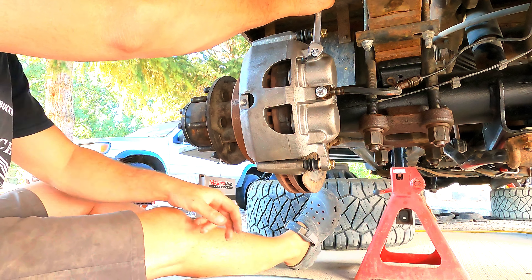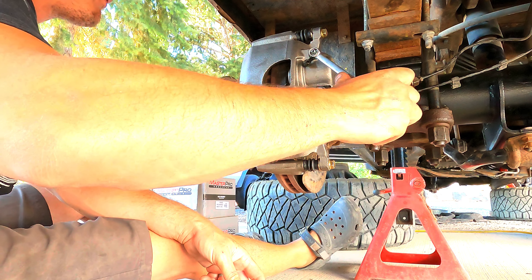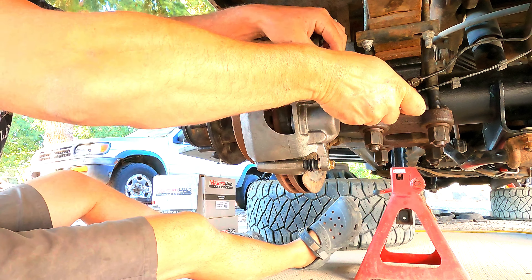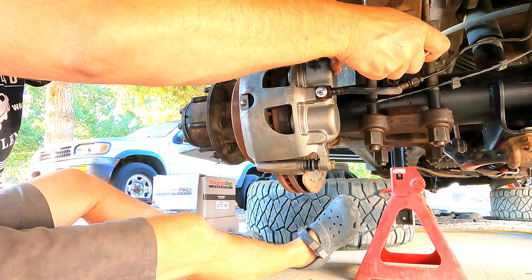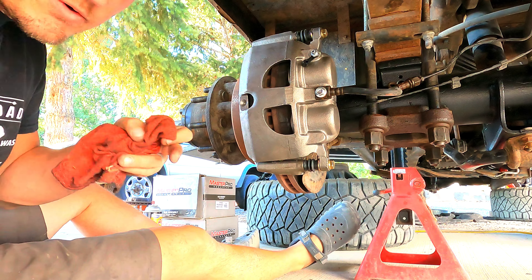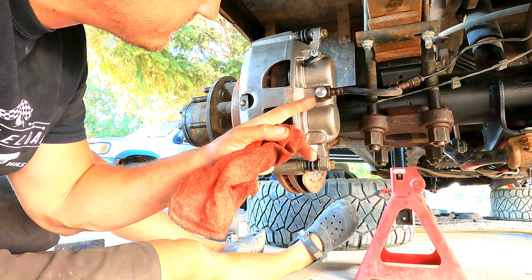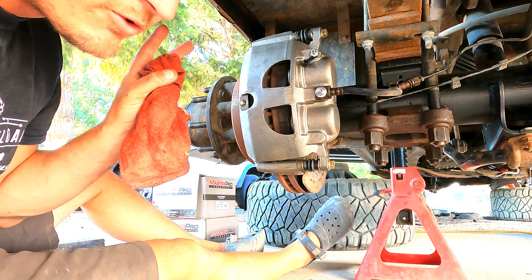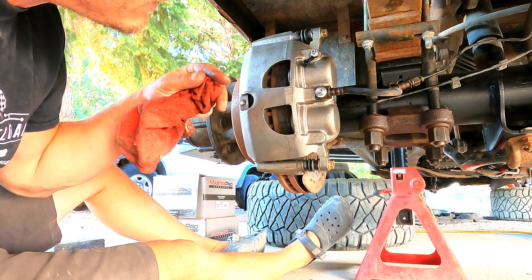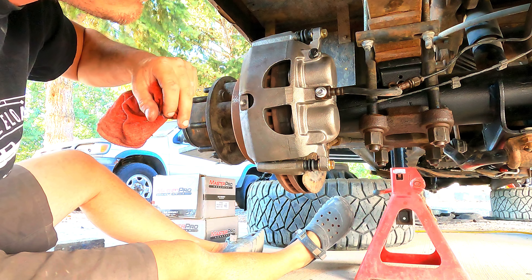Okay, go ahead. Tell me when it gets firm. Hold it down all the way to the bottom. Now lightly put your foot on the brake and then bring it all the way to the bottom — push, push, push. Tell me when it's at the bottom. We're going to have to come back and check on that guy, make sure it's not leaking. It was looking a little drippy when we came over here. I gave it a couple more snuggity snugs and hopefully that takes care of it.